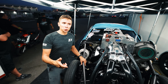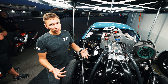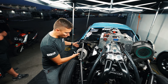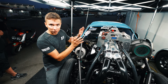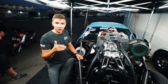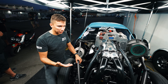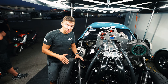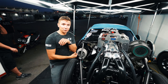When you do this, it allows you to run a longer first gear or even run as a two-speed, which makes the car easier to tame and handle. On this particular pro mod deal, it will make north of 5,000 horsepower, will run 88 to 98 — depending on the class and rules — with no wastegate on the exhaust at all. Everything from the engine goes to the turbo, and you only control the leak on the charge pipe. This is, on today's standard, how you properly manipulate a turbo combo. You can do the same on smaller engines, smaller turbos, different applications — same concept. Figure out your combination: head, cam, turbo — it works like a champ.